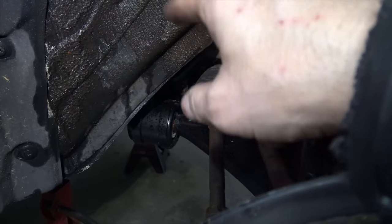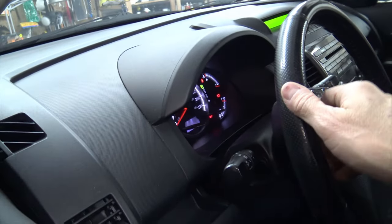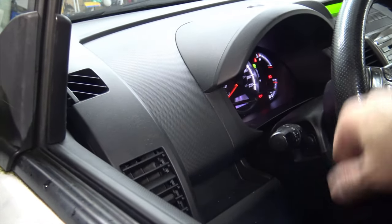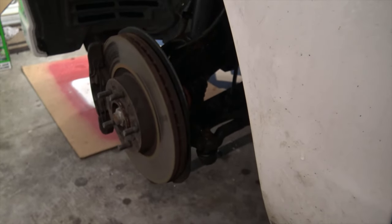There's a vibration coming through the steering wheel, and also when I turn the steering wheel you can hear a clunk. I shall attempt to demonstrate — this is just when you've got the steering turned, not going over any bumps, just listen to this if you can hear it. Hear that? Yes, that clunking noise is what's bothering me. I think that is the inner tie rod ends.